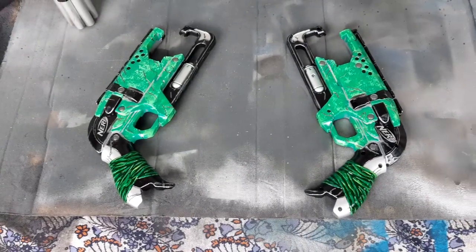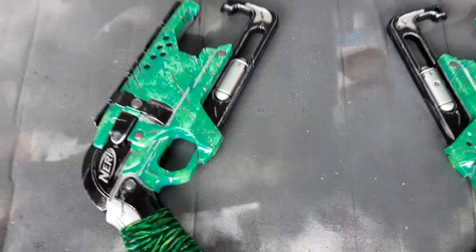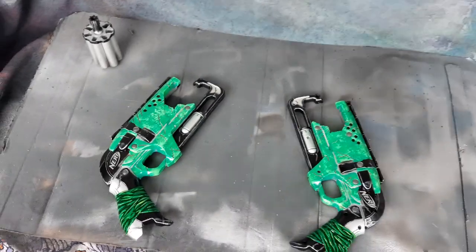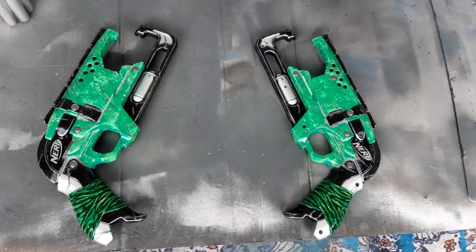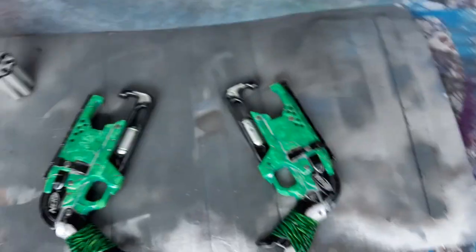All right, three layers applied. It's shiny and wet, and it needs to dry now. And because it's cold, I'll keep it out here for, let's say, 20 minutes or so to just air out, and then I'll put it in there. Because when it's cold, you run the risk of condensation clogging up in the paint while it's drying, so it'll sort of get some milky white. That's clear coat for you if the air around it is too cold or too wet.